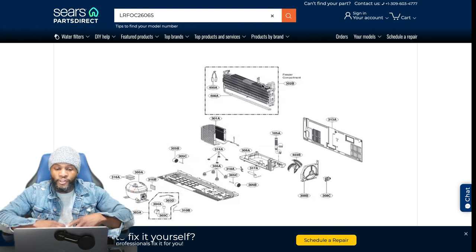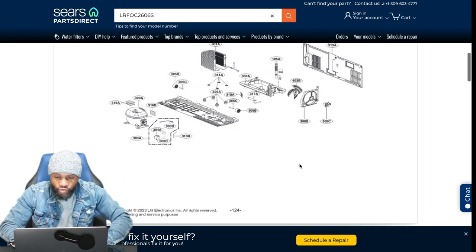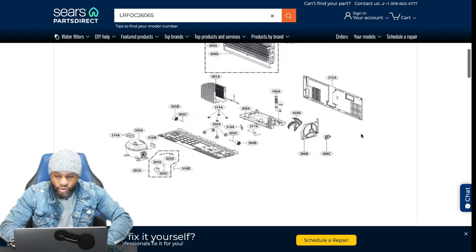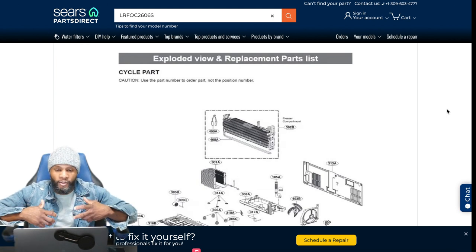Going inside the refrigerant portion of it where the evaporator is, this is your evaporator unit, your condenser unit, you got your compressor right about here, your condenser fan, you got your drip pan that's back here as well. And this might be an R600 unit, I'm not 100% sure, but if it's an R600, meaning it's a different refrigerant that they're implementing.